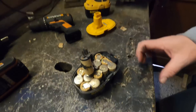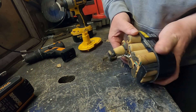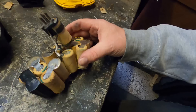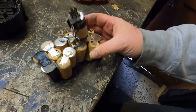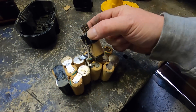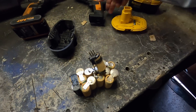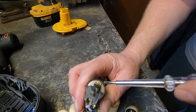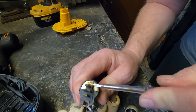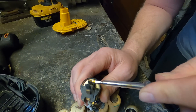Now what we're going to do is get this all out — you can see in all this glory just a bunch of small batteries making one big battery. We're going to disconnect all of this. You obviously need this connection part and the wiring, so we'll disconnect that first before we look at dismantling the drill. These contacts are sort of welded onto the top of the battery, so I'm going to try and pry them off — there's one gone.